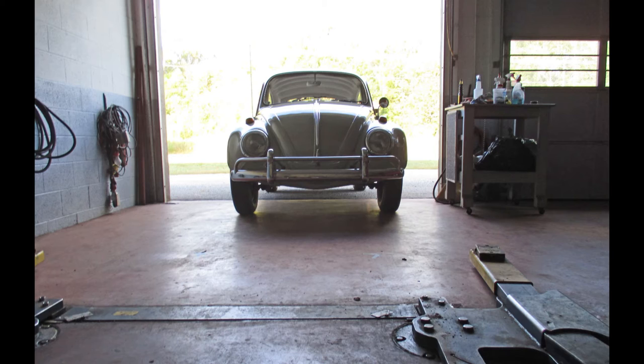But I had another problem, even before lining it up and getting the twitch out of it. I still had another problem: when you started to go into a curve, the car wanted to go straight, which is a very uneasy feeling. I researched online to see if camber would make any difference in the way a car handled as far as oversteer and understeer, and I could find nothing. So I thought, what the heck, I'll give it a shot and see what happened.